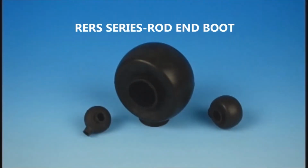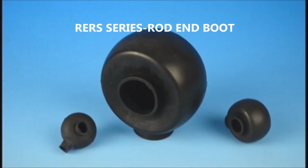It would collect the dust, and everything that's done in the desert now is like talcum powder, and it wears everything out in no time. Added to that, go through a puddle, have this dust in the cup. Darn if you weren't wearing this, even with the rod end seal, we couldn't keep it out. It was just an impossible situation. So while we're down there, John takes this and shows it to these guys, where it completely encapsulates the ball and keeps everything out, and darn if it isn't in standard production now.